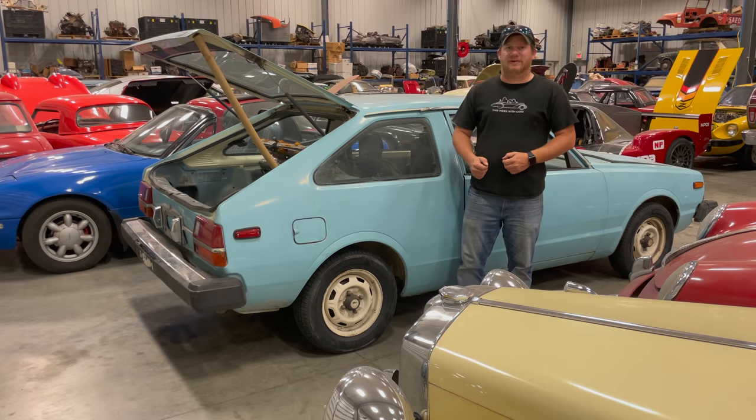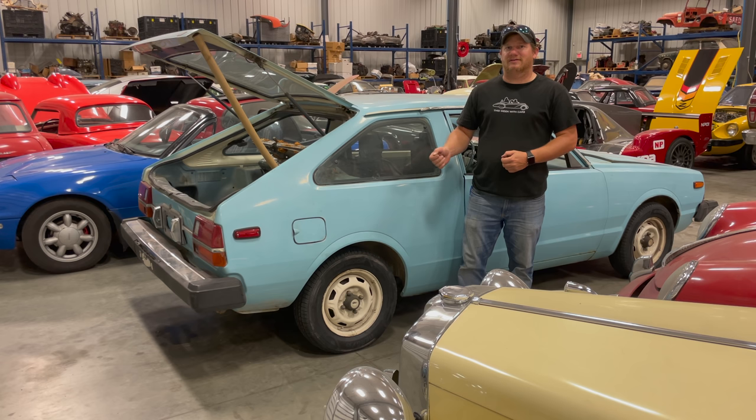I made it back. Here's what I think happened: my headlights stopped working probably because the fuse box is not very good on this car — there's a little fuse box in the engine bay that takes power from the 12-volt battery and supplies it to the 12-volt circuits. My lights went out just before I encountered a roundabout, and to beat another car around it I accelerated pretty quickly, then kept accelerating to get back to the shop. I think that driving heated up the cable so much that it melted the terminal right off the battery. There are some adjustments I can make on the motor controller to prevent this, but I need to fix a few other issues first.